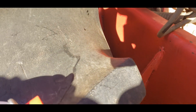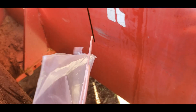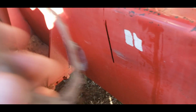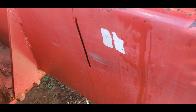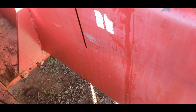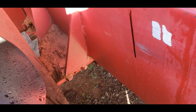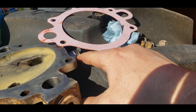I did some thinking while cleaning up. I want you to note how thick the MCBee gasket is compared to how thin the PAI one is. The MCBee gasket appears to be made of a more rubbery material whereas the PAI one is just normal gasket material. I'm not going back in with the original but I'll try to flatten it out for reference. I think the MCBee one is going to work better. Also, I had the crossover pipe in backwards.